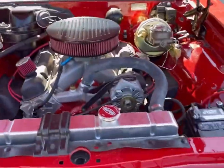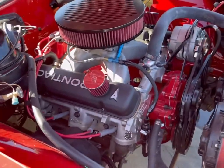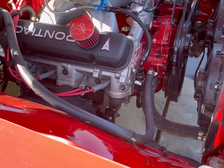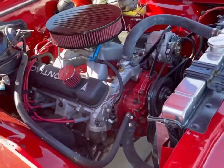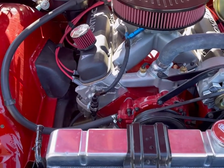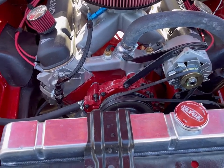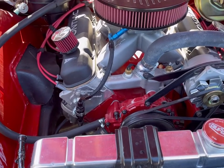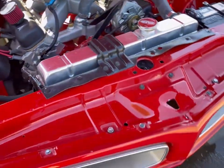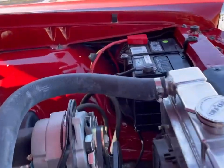Under the bonnet here, so this is a 389 four barrel two-speed automatic car. It's got a Turbo 400 three-speed in it now. That is the numbers matching, or that's the original block. I have the original heads, all that numbers matching stuff. Right now it has stock rotating assembly with forged lightweight pistons. It's all been rebalanced, remachined. Some good Kaufman Racing aluminum heads, single plane intake from Kaufman, cold case, electric fans, MSD, and I hid that back there behind the battery box.